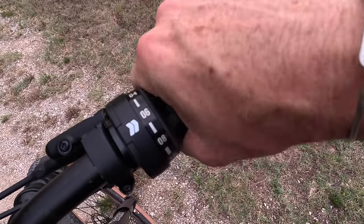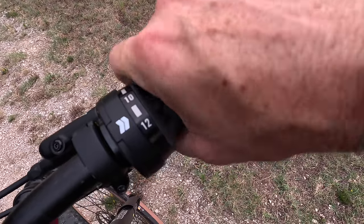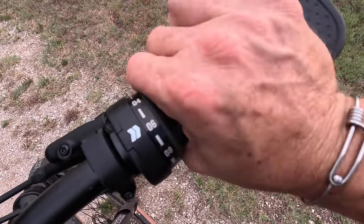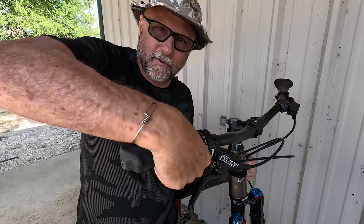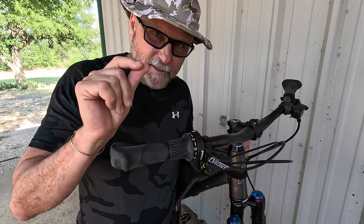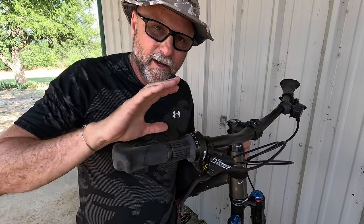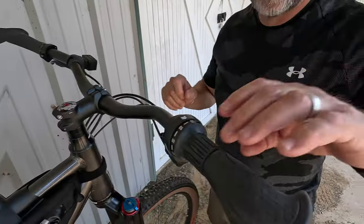And the thing that's nice about this, when you're out riding trails and you come down a descent, you don't really know what's up in front of you, but you come down a descent and whoa, there's a heck of a climb and you haven't prepared by shifting. With this, you throw it all the way down and then you're climbing up, and you can do that in a split second by just that split second stop pedaling, move it to whatever gear ratio you want. It's not going to hurt it at all. That's how you have to shift with this.